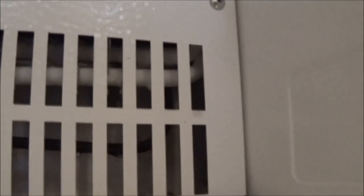The big block of ice. Now up in here, I've seen guys use warm water. It looks like the drain is probably over in there, but I don't want to do that. So what I'm going to do is I'm going to close this up, I'm going to back this refrigerator out of here, and we're going to go in from the back and see what we can see.